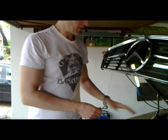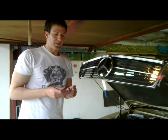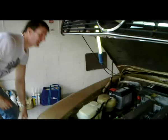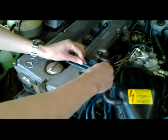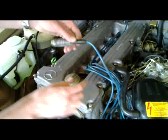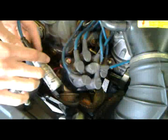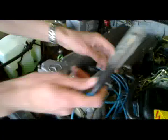There is another important thing: you should not put any tools into the engine, especially not into the inner part of the engine or into this part of the car, because later you might forget them and damage your engine. Simply put tools somewhere else when you don't need them. Now let's unplug the cables. I will loosen number 4, number 5, number 6. This is number 1 — it goes in over here. Then we will loosen number 2, which goes in over here.